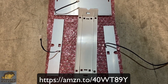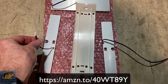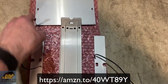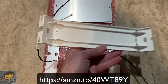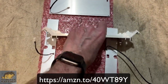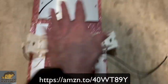A quick piece of strategy when laying this out: put these pieces as they will be up top. Remember that connector was on the left side — so you'll want this LED with the short one on the left side, and the longer one on the right. Then you want the connector from the big panel also coming on the left side. When we flip this over, remember it hangs just like this with those connector pieces that go straight up. The big piece will lay across, so if we put both of those on the left side, it'll easily just snap in.